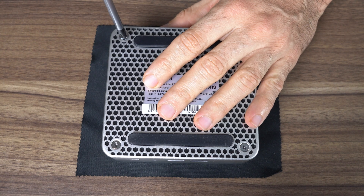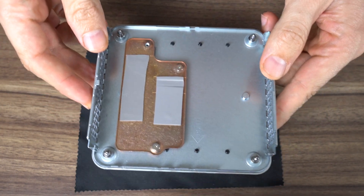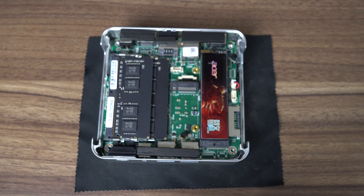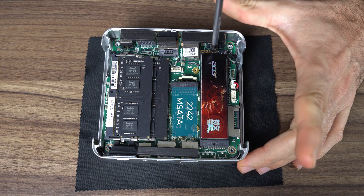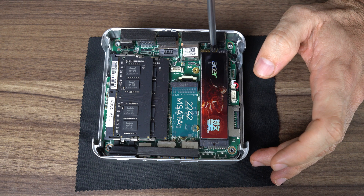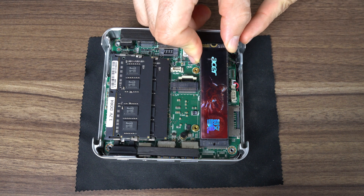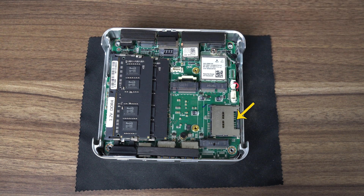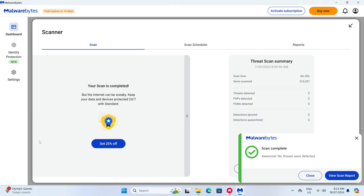It's easy to open this mini — four screws and jiggle off the bottom casing. The M.2 drives connect with thermal pads to a copper plate for cooling. The unoccupied M.2 slot is a 2242 M.2 SATA. An Acer Gen 4 NVMe storage drive is used for the OS, which based on previous tests will be a good performer. Dual-channel DDR4-3200 is included. Interestingly, the board also has an SD card reader and a SATA ribbon port, both blocked by the case. Geekom's XG13 Pro comes with Windows 11 Pro, and no issues were found scanning the OS for malware.